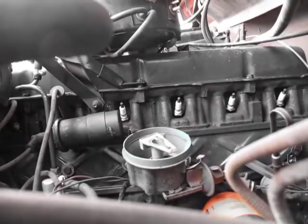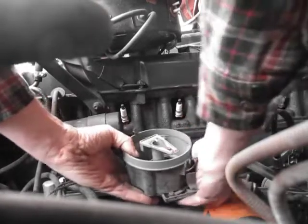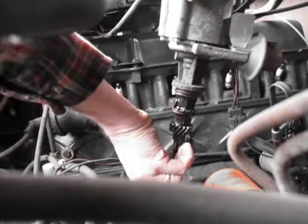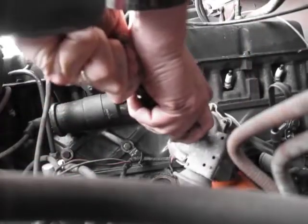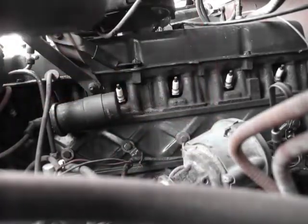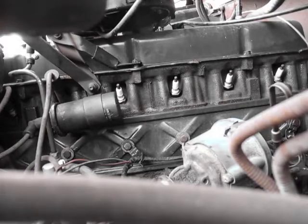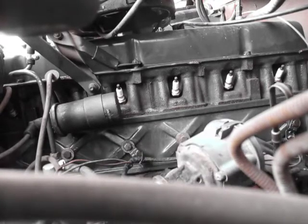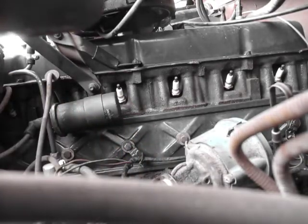We're 11 minutes in and I haven't done anything yet. So wires are going to come out with this and this is going to spin a certain way. There we go - spun back. It lifted the rod out with it - the rod for the oil pump. That's going to be fun. It's definitely going to be a two-part video. I've got to figure out about getting this oil pump rod off and positioning it in the correct manner. Distributor looks like it's the right one, but the new distributor does not come with the oil pump shaft. I might have to clean up some debris there so it doesn't fall in the engine. Next video - ta-ta for now.